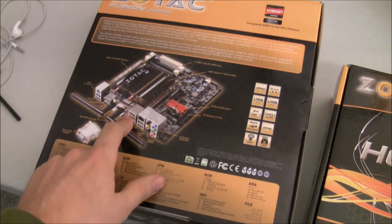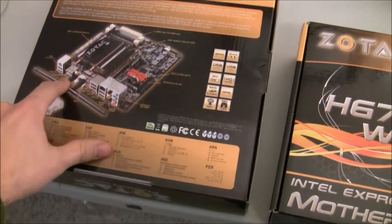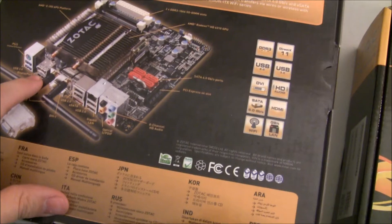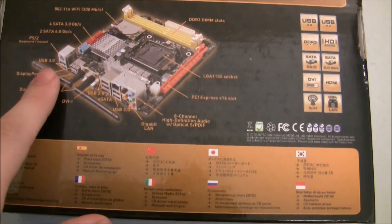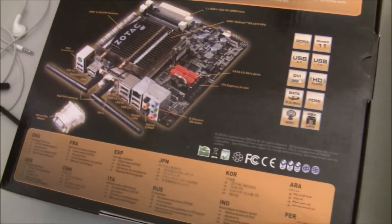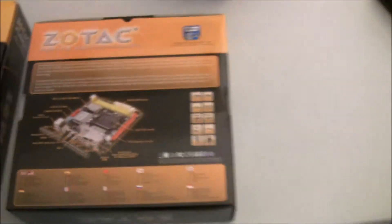What I found is, this is the motherboard that's in the Nintendo PC right now. If you look on the back, it has specific ports in a specific location — namely, the HDMI port right next to the USB 3.0 ports. I found Zotac offers another board that has the exact same setup. You've got your USB ports with the HDMI, so it's actually the exact same configuration for the rear of the device.